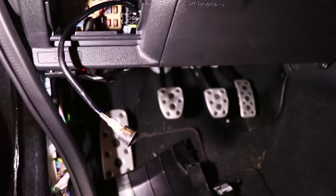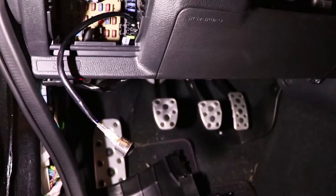And so once you put the wiring harness through the hole in this grommet, you can reconnect the switch if you took it out, and you can kind of put it up near the fuse panel. And if you have a blank, which most people probably will, you can put it there. I decided to just leave it by the fuse panel for the time being, because I wanted a switch that looked a little more OEM. But by the time this video comes out, I'll most likely have found a solution, so I will make an update video on that and what I did.